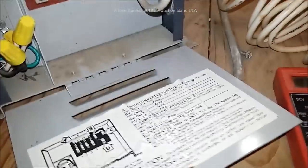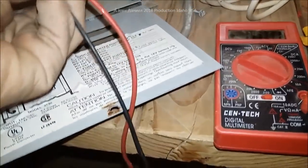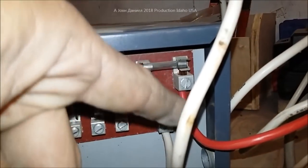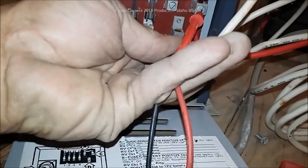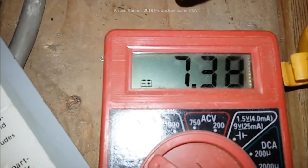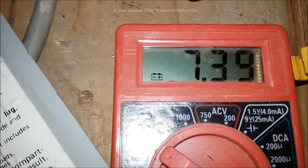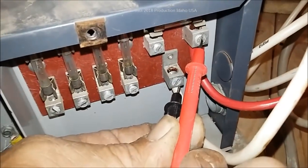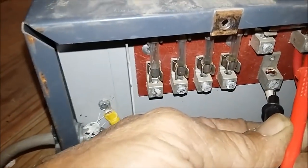This one was for a 24-foot trailer. You might wonder if your unit is bad because you're getting odd voltage readings. Over here would be the battery link and here's its fuse. You might be getting a really odd reading — I'll show you here — showing only seven volts, and you're thinking your battery charger is bad.